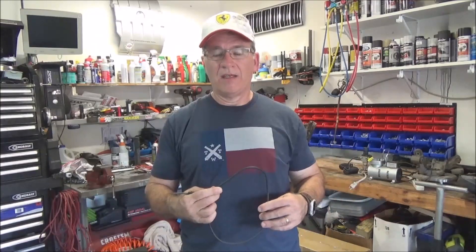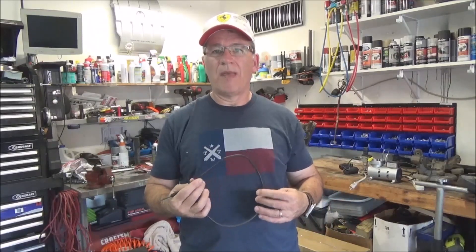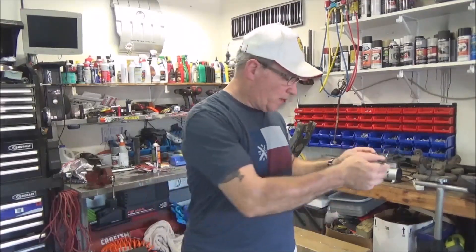I've tried to find out what the CFM is on those two fans and haven't found anything. This is the same set of fans that most GM cars from about 2013 through 2017 use — Malibus, Impalas, probably the Buicks. If you see anything that shows the CFM of Fan 1 and Fan 2 and what the draw is — I know it doesn't draw like the Ford Taurus fan does. That 3.8-liter Ford Taurus fan is a two-speed fan, and on high it pulls something like 4,500 CFM — a monster amount of air. But that fan was designed in the latter part of the 1980s, so efficiency probably not as much as a modern fan. If you find that info somewhere, let me know and I'll post it so everybody can have it.